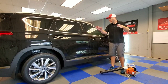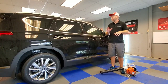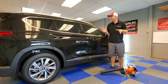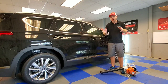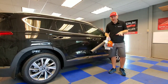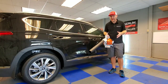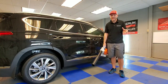I just got the car back in the shop after washing it. I immediately pulled it in because I don't want to get any hard water spots on the vehicle — I want to dry it as fast as possible. The paint was in really great shape with very little contamination. I've still got a clay bar to do, so to touch the paint as little as humanly possible I'm actually going to use a leaf blower. You can use an air compressor or a dedicated car dryer — I just find these are the fastest, most efficient method.